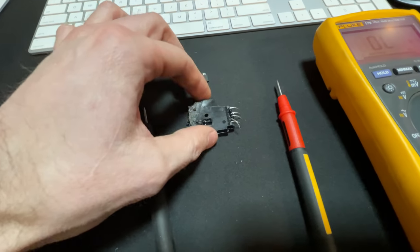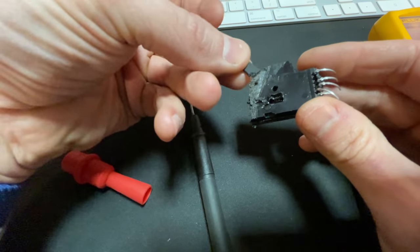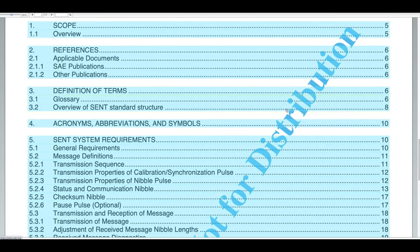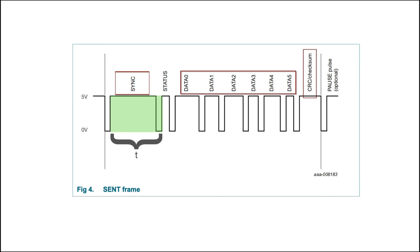Here's the really interesting part. You remember how I couldn't get any changing voltages or resistances out of those wires? That's because this sensor communicates digitally using a one-way high-speed protocol called SENT. This is a Society of Automotive Engineers protocol, and it's used by a lot of car companies on new cars for things like throttle position sensors and airflow sensors. If you don't know what this is and you work on cars, listen up, because this is going to be important in the near future. It's a super simple way to communicate — it uses one wire in one direction. The sensor sends zero volts or five volts down the wire, alternating between the two. The computer on the other end measures the time between the spike from zero to five volts and the next spike. The number of microseconds between those two spikes tells the computer what angle the sensor is at. It's a little more complicated than that because it sends multiple bits of data and calibration pulses and error checksums, but it's essentially just sending a constant stream of digital data. Whenever the body controller wants to know where the door handle is, it just looks at the time between the zero-to-five-volt spikes and it knows what's going on.